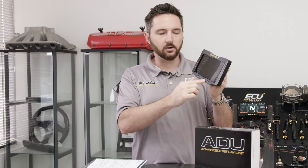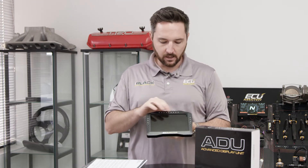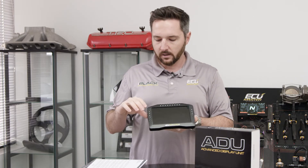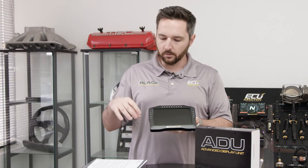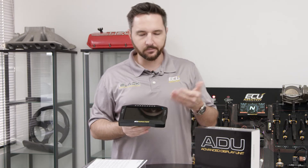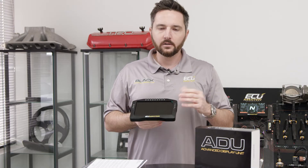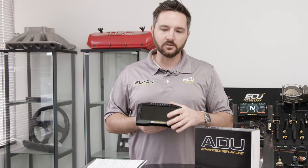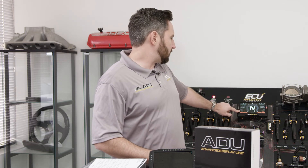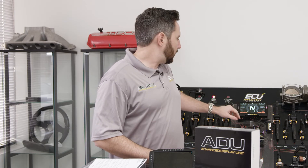You can reflect it top to bottom so you can see your indicator LEDs. You do have 15 indicator LEDs. I generally use the top bar as a progressive shift light because it's very visible with lots of brightness. The ones on the side I'll use for warnings, reminders, or maybe turn on blue if it's logging when certain conditions are met. You can have it blink when your turn signals are on, or use an icon on the display itself to show a function is on or off — like battery voltage indicators or a ghosted check engine light when it's off.